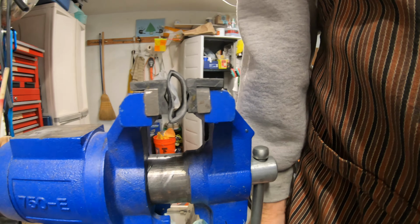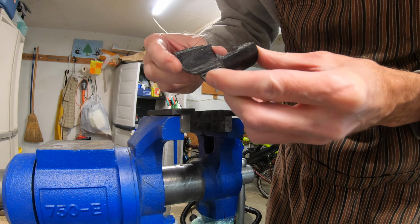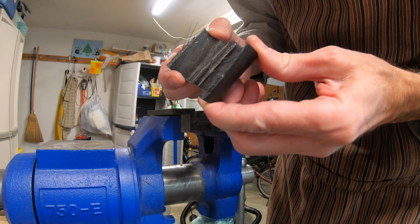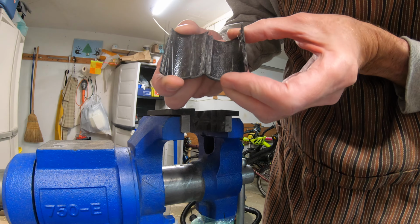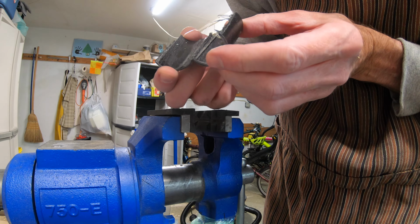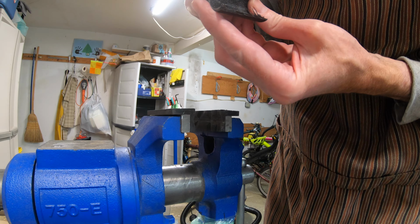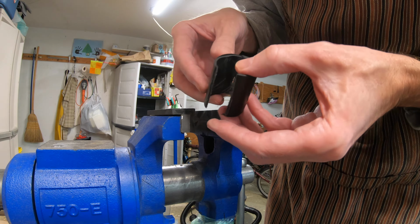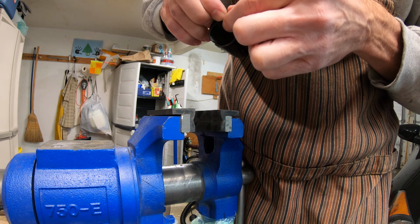All right, that is well and truly destroyed, and still doesn't want to come completely apart. So there you got your broken strands. Your vertical elements, which are what give you your stiffness, and not a ton in the way of circumferential, which is what you would expect for this, because what you really want is stiffness along the axis. The only place you can really crush it is the top, where you should have a plug-in. See, we delaminated it here, the two different layers of fibers.